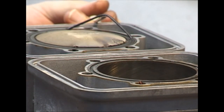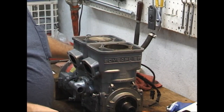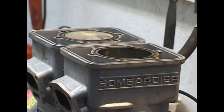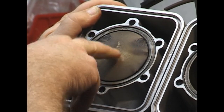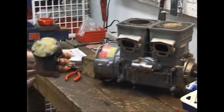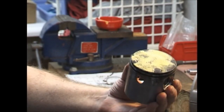After three years your seals are shot. This is a five-year-old engine. One thing we can tell about this engine is he's been using Avgas — aviation gasoline. It's been stored for the last couple of years at an airport. If you burn Avgas, you'll get either a yellow or a whitish coating. This one's more yellow — where they've used it for long periods you can see how yellow this is. It's just a deposit of lead, because it's a low-leaded gas, not an unleaded gas.